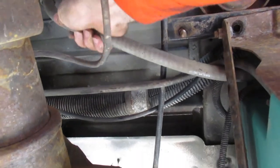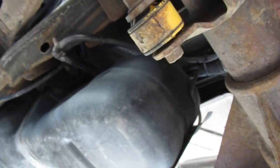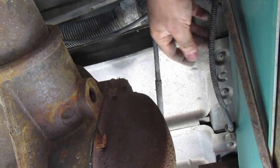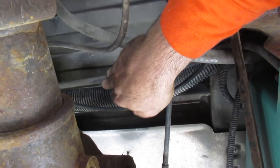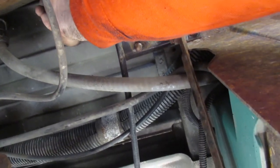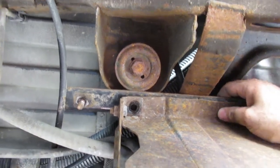The power cable is a little bit tight but it's good — there's still lots of slack on the inside of the vehicle so it's not going to be putting any tension on the wiring terminals. The fuel line is fine. The battery cable connector — I'll have to attach that to something, it's kind of floppy now. There's the control connector up on top, it's kind of flopping around. This is supported so it's not going to land on the differential. That's the differential breather tube right there. Just checking to see that the top isn't full of garbage — it seems like it's okay. So it looks like it's all going to work out — I just got to finish up the bolting.